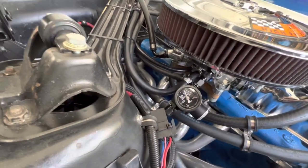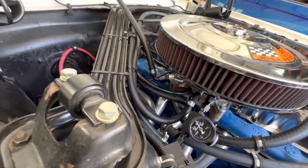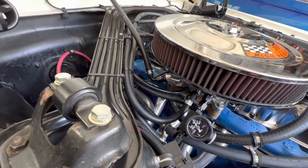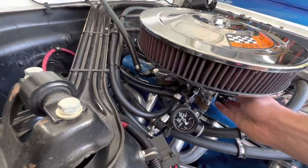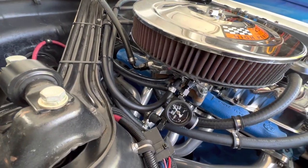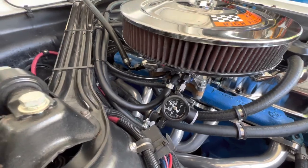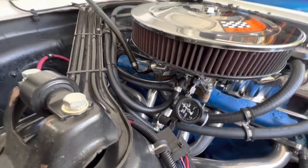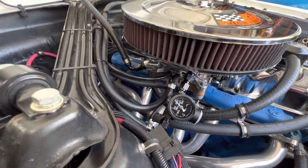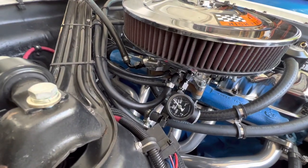More consistent fuel pressure — it does appear you could run it this way. You could run it with the retrofit unit but add a return line if you wanted to. This is just a quick and crude way to do it, sitting in the garage here, but it does appear to be keeping it consistent. Did we learn anything? I don't think so. It still needs a return style system in the tank. But it was an experiment I wanted to try — I wanted to see what would happen if I hooked up a return with a regulator in the tank as well.